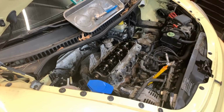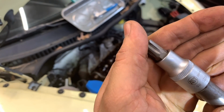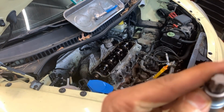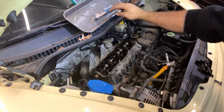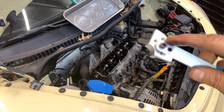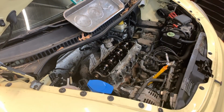All right, all is good. It's a poly drive socket, and this is the part number from Ashermarker. Hopefully you guys can see. It says BW 5220. It's a very specific socket. And the tool that I was referring to for the tensioner is a very basic one. It's this one, and you can set it up in different positions depending on room. So that's it. Okay, I can put this tensioner tool back where it belongs, and we can start releasing the cylinder head.